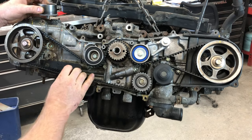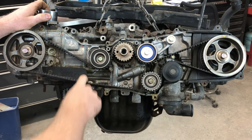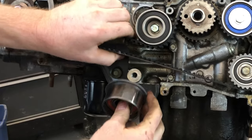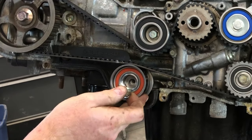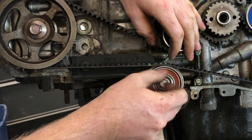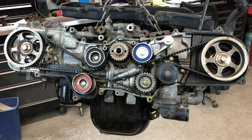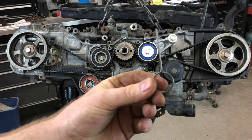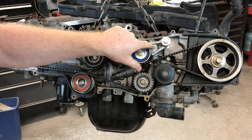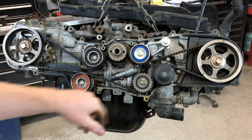Now all this extra play — we can get it all back down here, and that will enable us to put this pulley in. We slide this in and you can see that bolt hole lined up really easily. We hand-start that bolt and tighten it up. Done. One last thing: pull your pin — that's just a little kind of a grenade pin. Once that's pulled, this hydraulic tensioner has a spring in here and it's actually gonna push against that dowel pin, and it'll keep this belt tight for a hundred thousand miles.